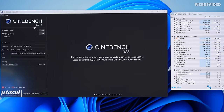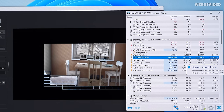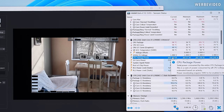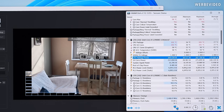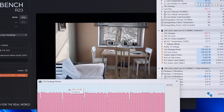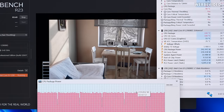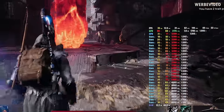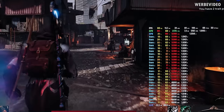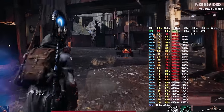All-time classic — we'll start the tests with Cinebench R23. As expected, the 12900KS does not disappoint and we can see a CPU package power draw of between 260 to 270 watts. This is a good indicator of how much heat the AIO can dissipate. In this first run with the H150i, it's about 270 watts and the CPU package temperature is at 101 degrees Celsius. After a steady load of 6 minutes there's no big change anymore, and continuous heat dissipation is about 240 watts. In a lower load scenario such as normal gaming, CPU core temperatures are between about 60 and 80 degrees Celsius. I'll lock this scene with HWInfo in the background and get an average CPU temperature for a better comparison value.